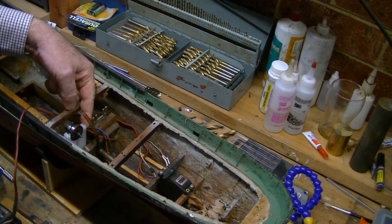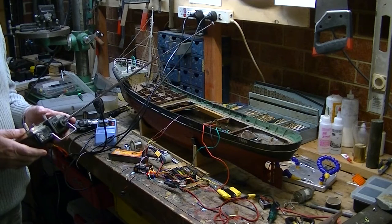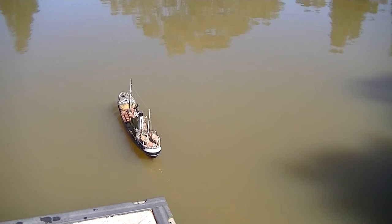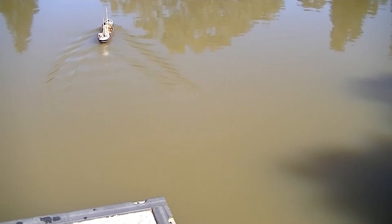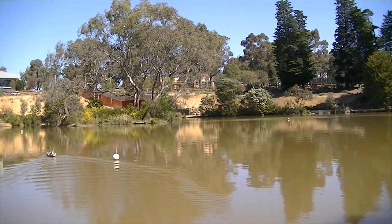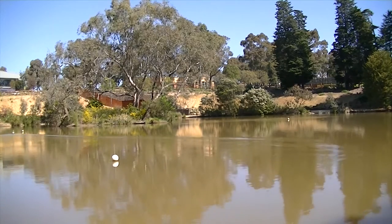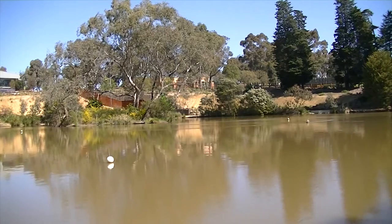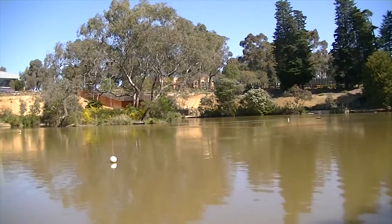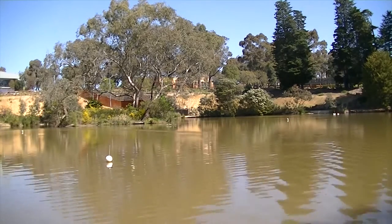I'm going to give it a run now and see how it looks. This is the first time it's run with a brushless motor, and the result's OK - pretty happy with that. Right from the beginning I found that, and I have absolutely no doubt this is due to the 3-to-1 reduction - it could actually be almost 4-to-1 - it really nicely puts this ticking the prop over at the right speed. I think that looks about the same speed as before. This boat really does have a maximum speed due to the hull shape and wave formation, but this looks right and I'm pretty confident.